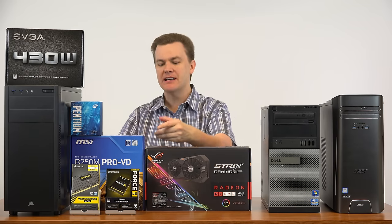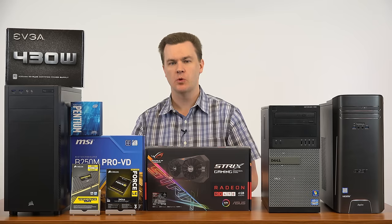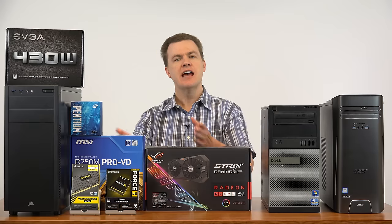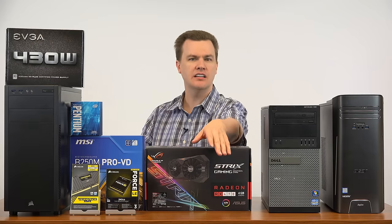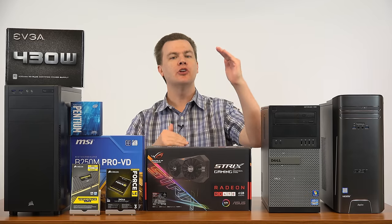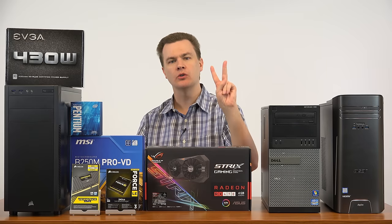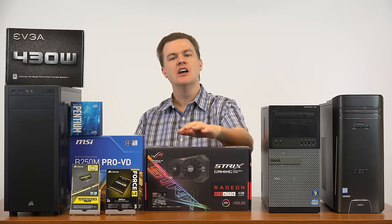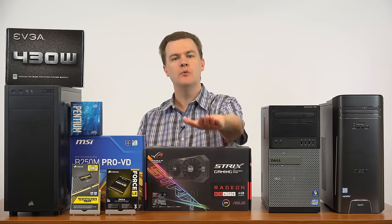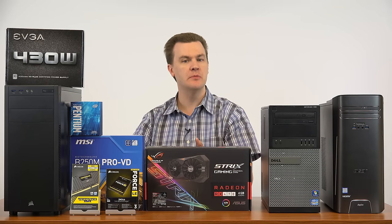To support CrossFire, I'd suggest spending $25–$35 more and buying a larger ATX motherboard with two graphics card slots. MSI has a B250 board for $90 and ASUS has one for $100 — they're larger, have four RAM slots instead of two, giving you room to upgrade RAM, and they support CrossFire with two RX 470s. So if you think you might want to upgrade in the future, spend $25–$35 more on the motherboard, buy the RX 470, and you can add another one later. You can also upgrade to an i5 down the road.